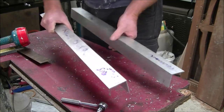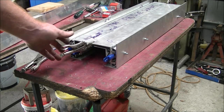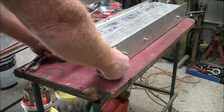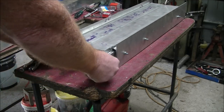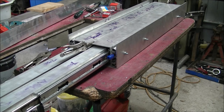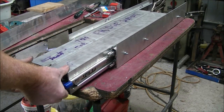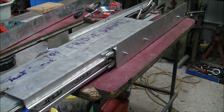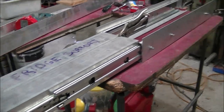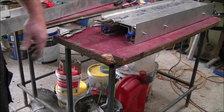We now have both left and right hand table slides and are ready to bolt it all together before moving to the next step. I've bolted all the angles to all the slides and brought them together to demonstrate how it works. If you want to use the fridge, use the outers — that's your fridge slide. Pull out the inners for the table. If you want to pull out both, pull the fridge slide to full extension, then pull the table out to full extension. Overall that gives us 1.4 metres in total length.